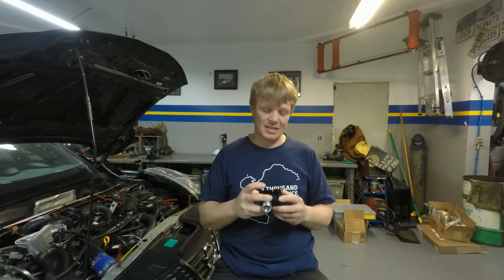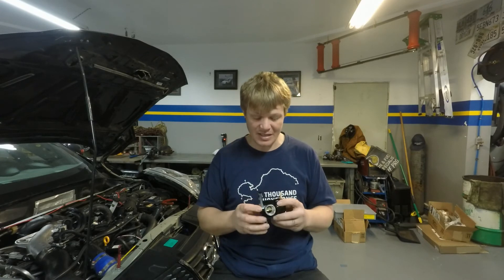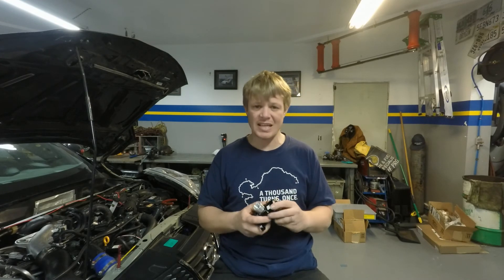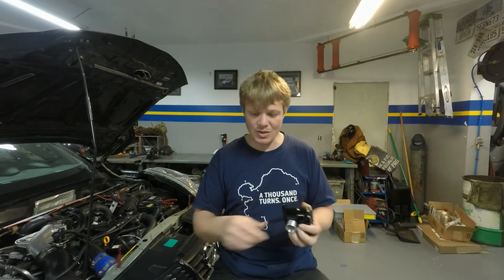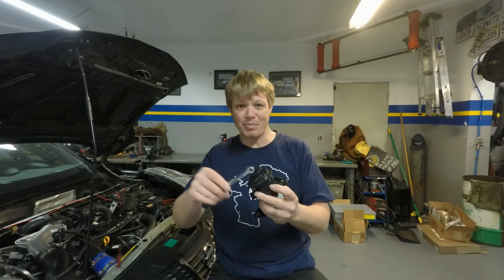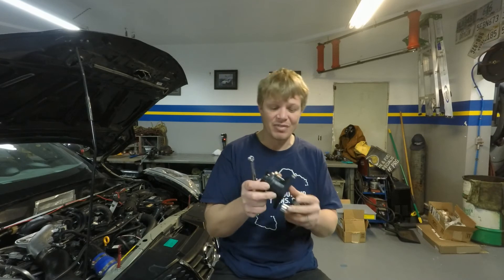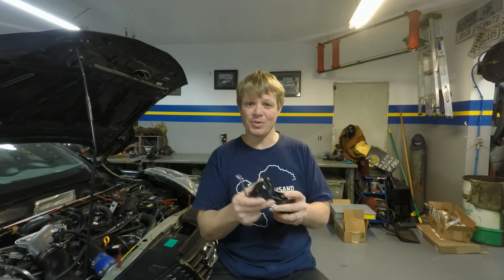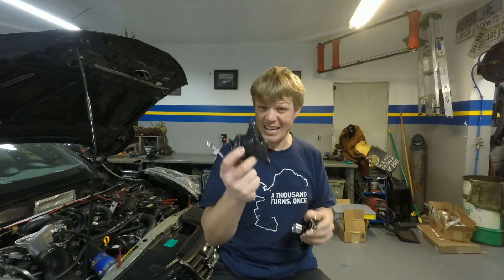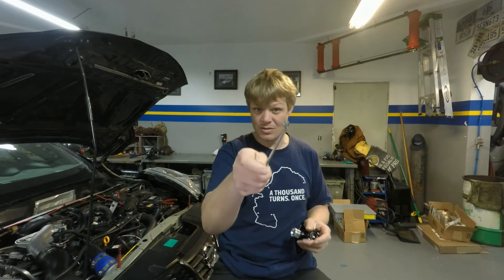Another really big reason why I like using these guys' products is, number one, their construction. This valve is really, really well built. Each piece is built out of billet aluminum and fits precisely — there's no play in any of the adjustments. Two is the materials they use: billet aluminum versus the chintzy plastic the factory uses. The factory valve might be okay for stock pressures, but when you start getting bigger turbo kits or higher boost from tunes and such, that valve might crack or warp, causing boost leaks and costing you horsepower.